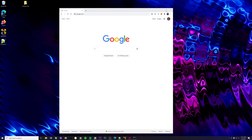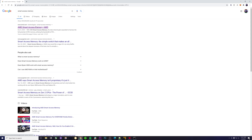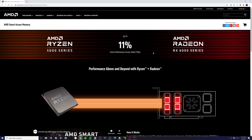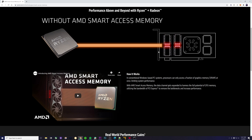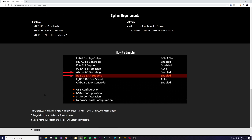What we're going to do here is show you guys how to get your smart access memory enabled. It isn't enabled by default. If you do have a 5000 series AMD CPU and a 6000 series GPU, there is a boost available to you — a gain — that is called smart access memory. In order to do that, you need to have those two things, and in your BIOS, you'll need to enable above 4G decoding and resize bar support. Doing those two things will enable your smart access memory.